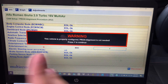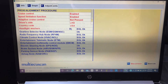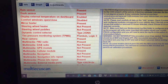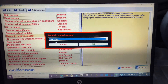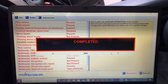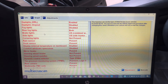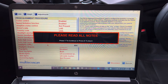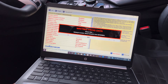It's going to tell you it's not needed because we've already done it. Go over to Adjustments, scroll down to Dynamic Control Selector, go to Type, then Execute. We're going to do Type 2 because we already did Type 2. It's going to say Completed — click Yes. Then scroll up to Proxy Alignment, click Execute. Please read all the notes and click Yes. This is where you kind of have to go fast.